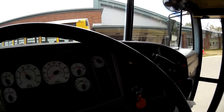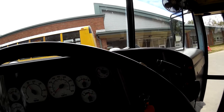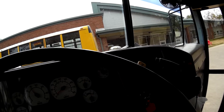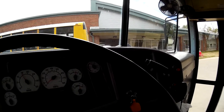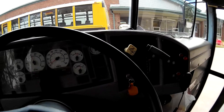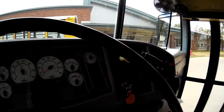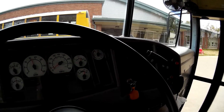Not all buses have airtight systems — almost every bus I've ever driven has had some kind of an air leak. You can park it with 30 pounds in it at lunchtime and come back and it's empty, because there's a slow leak somewhere. But it's so slow and so small it really doesn't matter. And that annoying alarm should go off around 60 pounds and will continue to climb to around 120 pounds.